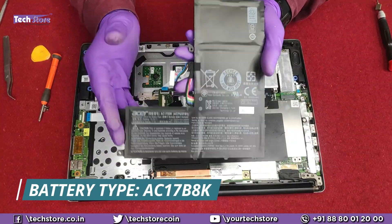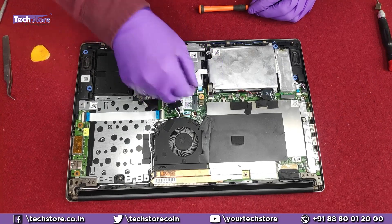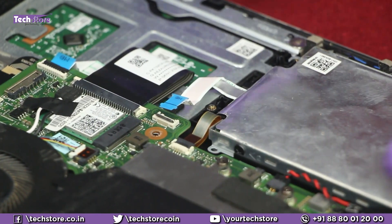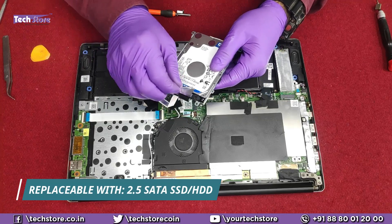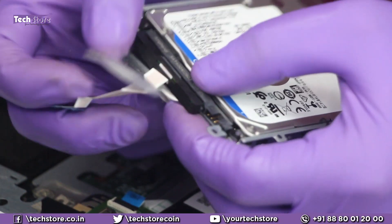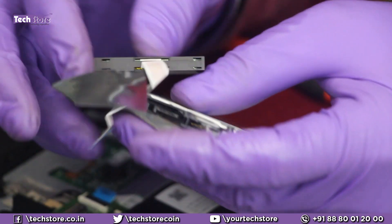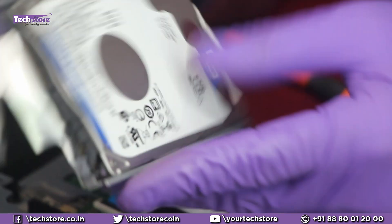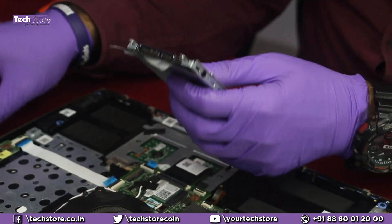For the hard drive, remove the screws connected by the strip connector, then remove the strip connector. Just below the backlit strip there is another screw — four screws in total — and you can remove the hard drive. You can take a 2.5-inch SATA SSD or HDD to replace it. Just remove the HDD connector using your two thumbs and it comes right off. Remove the four screws on the caddy and you can replace the hard disk very easily.